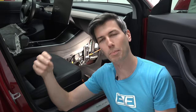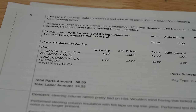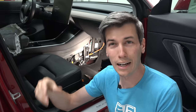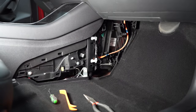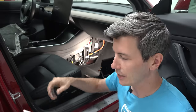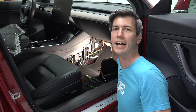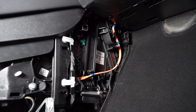My air conditioning smelled terrible, so Tesla replaced the two cabin air filters and cleaned the evaporator — that cost $125. What I like about this is they charged $50 in parts, which is pretty much what you'd spend on parts whether you do it yourself or take it to the service center. Then it's just whether you want to spend the $75 to have someone replace it for you. It's not necessarily the most difficult task, but it is a bit more difficult than you might assume — it's kind of buried away up in there with a screw that's difficult to access.